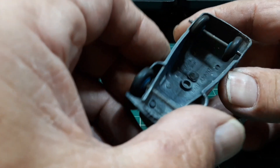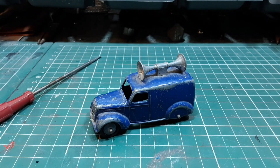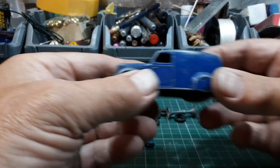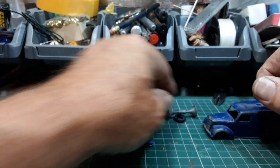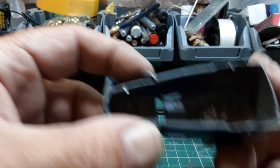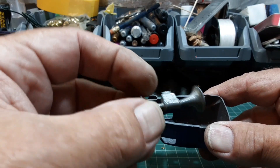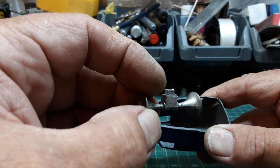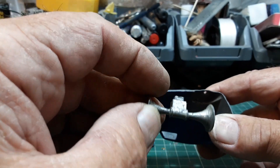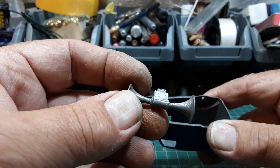I would say it's a bit tight to be pulling that apart. Right, I'll get these axles off and the speakers off. Here are the parts — got that off. What I did — this is a square rather than a rivet, so I had to grind it off from inside there. That was quite tough — just ground it with a grinding wheel and then it just pushed out, poked out. So that'll clean up; they're going to go caustic and then it'll get redone to bare metal obviously.